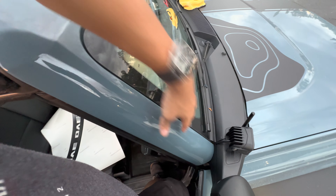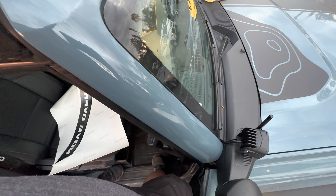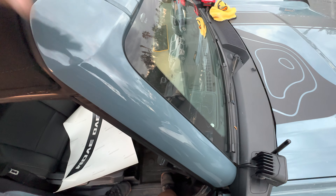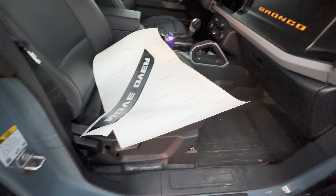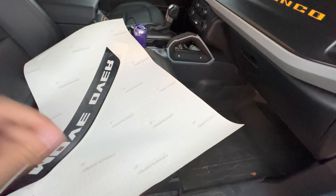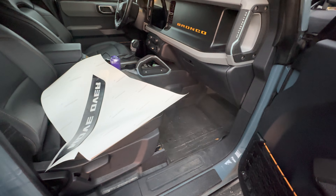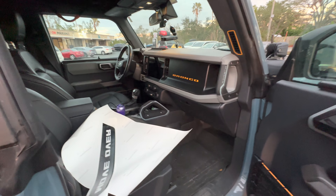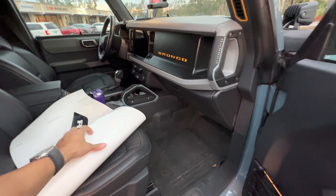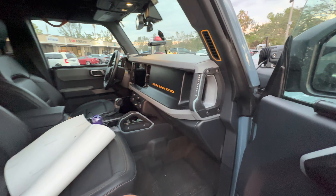What I did is I cleaned it and then sprayed the Sticker Fab application fluid all throughout this area. Then I came back and took off the PPF liner inside here because there was little to no wind. I peeled it back a little bit, sprayed, peeled it back some more, sprayed, until the whole area was drenched — so it won't stick on itself and it's ready for installation. Make sure to clean your hands. You want your hands to be as clean as possible because you don't want to leave dirt, grime, or fingerprints on the back of the PPF. Keep them clean throughout the installation; if your hands get dirty, go back and clean them again.